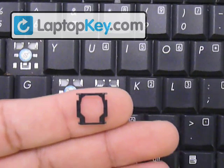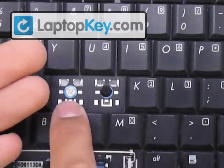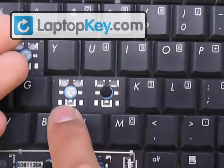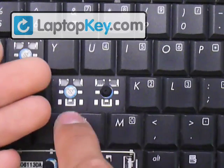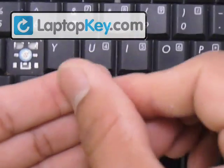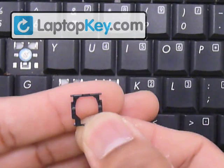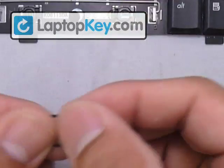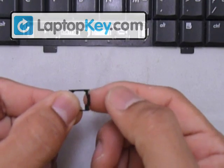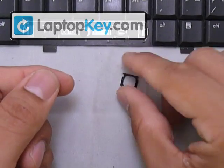The large hinge piece has two pins at the top and two smaller ones at the bottom. The small pins align with wherever the large hook is. Make sure not to put the entire piece upside down — it looks the same but it won't work. To check orientation, feel underneath the vertical bars: if you feel a bump in the middle, that side faces and touches the keyboard; if it's one smooth piece, that side faces away from the keyboard.